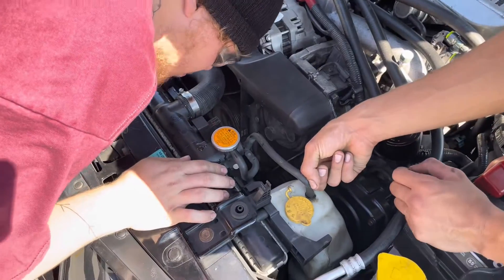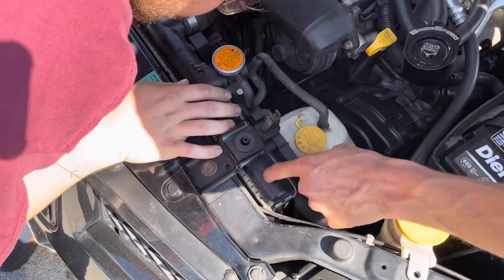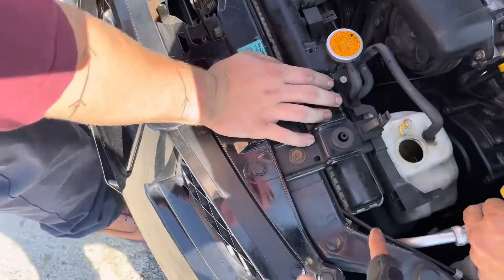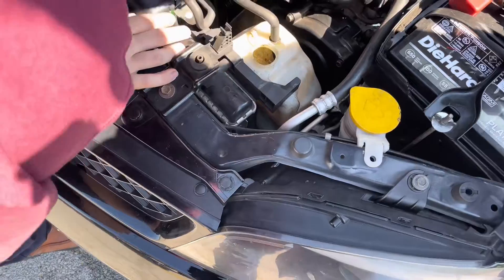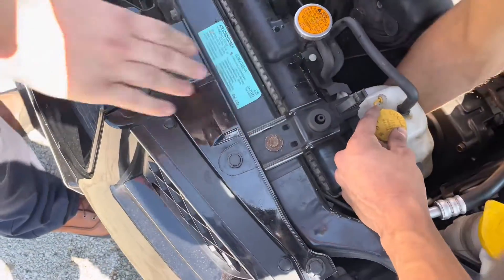I try to feel up here — it's not there. There was no coolant inside the radiator when I first bought the car, and the coolant that's in here is not getting its way all the way through. My guess is it's either going to be a blocked coolant line down here.